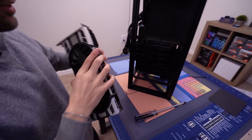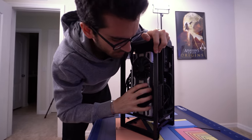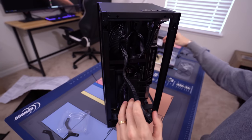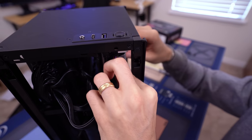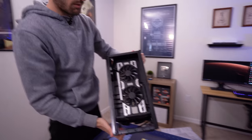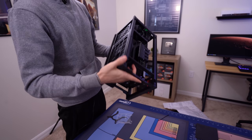Let's get this graphics card going. You do have two thumbscrews here at the bottom, just like in a conventional case. Move these first, then slide it in — it just clicks in. I'm going to lock it in place. One of the good things about having a modular power supply is you can remove cables you don't need to reduce clutter. What we need to do here is just connect one 8-pin supplemental PCIe power. We've got a GTX 1070, 2700X, SSD. There's an AIO baked in and a modular SFX power supply.